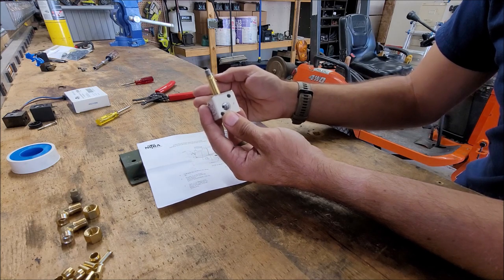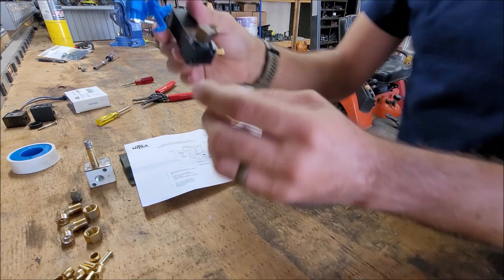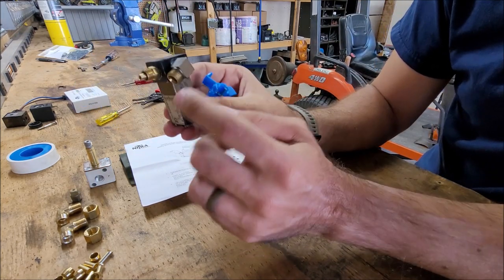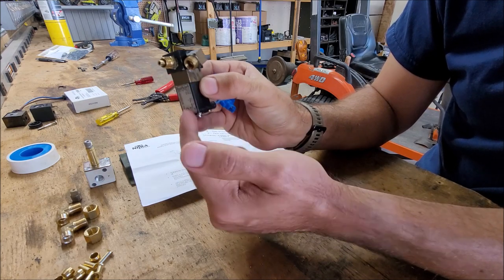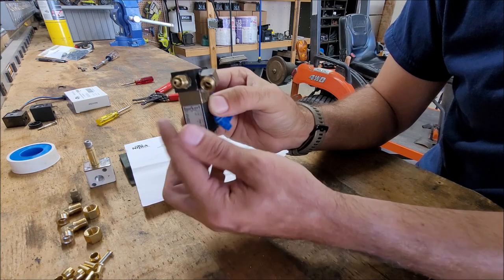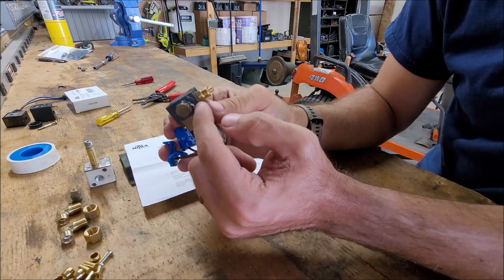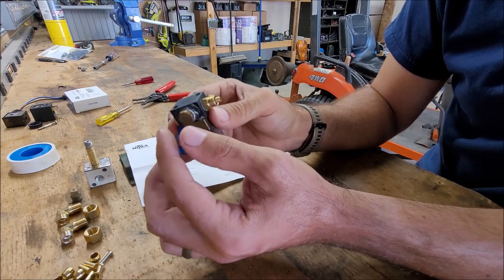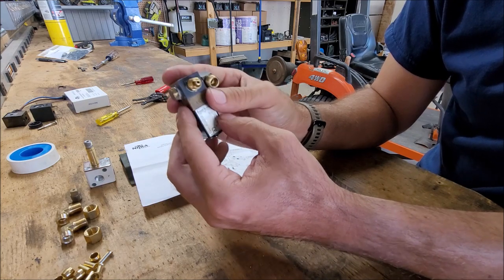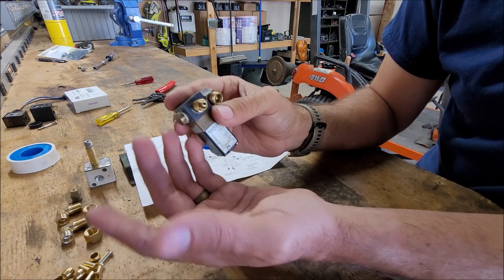So you can stack the valves and add multiple valves, which is very similar to what is going on with this, where this is your air coming in. This is mounted upside down. Then the solenoid opens and closes to feed or dump, vent the air going to the fan this way. And this is capped off because nothing's going this way. But I believe on the MTVs, this block is double the length and air feeds over this way and goes to the second valve that either sends air or vents the air to lock up the intermediate axle.